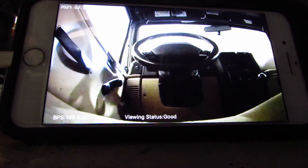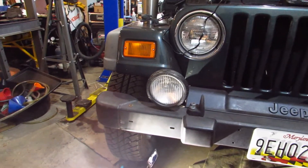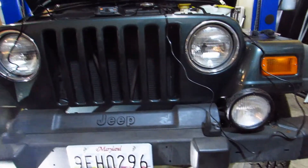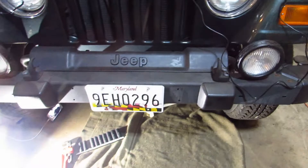I'm going to jump in the Jeep real quick and see what she looks like from inside. Yeah, that looks pretty good. Now all that's left to do is tighten those bolts back up and your steering wheel is straight again. Real quick — in case I forgot to mention: before you do this, get in the Jeep and turn the wheel until your front wheels are both pointing straight. I did that first. Everything's straight now — steering wheel straight, wheels pointing forward. Tighten those two bolts back up and that's it. I hope this was helpful — please like and subscribe, and we'll see you next time on Dirty Dave's Garage.